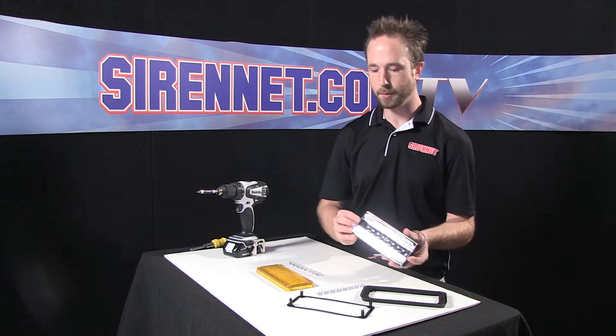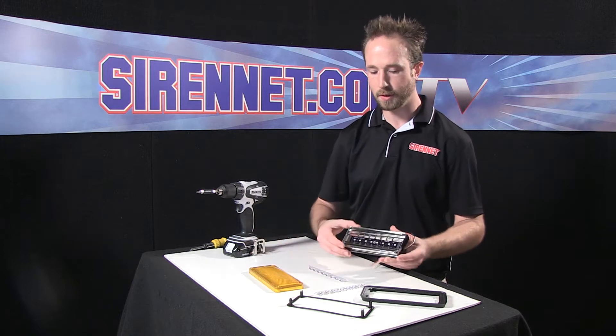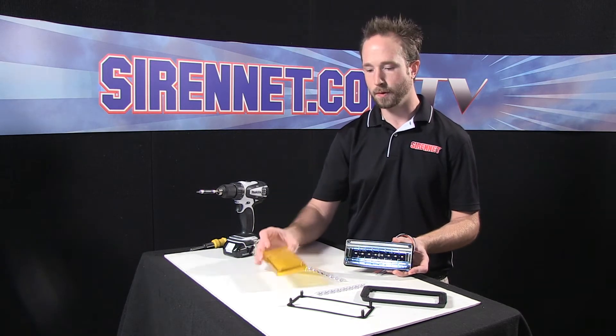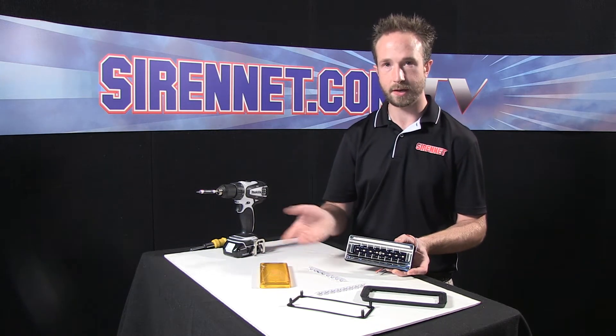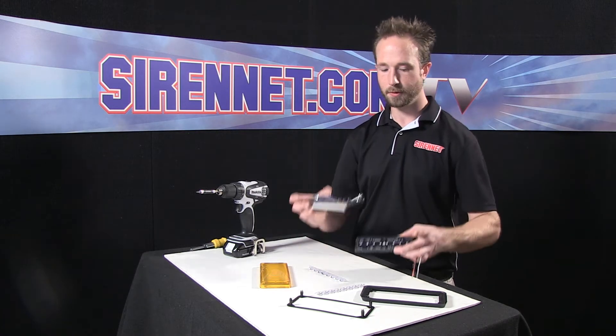So again: diode board assembly, hourglass optics, outer lens. And what's neat, since the diodes produce your color, the lens itself is really just cosmetic. So if you want to have a clear lens for your application to match everything, or color-matched lenses, it's up to you for whatever choice you want your light heads to be.